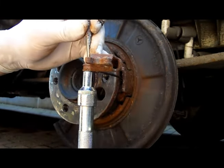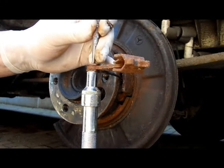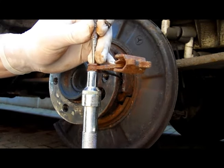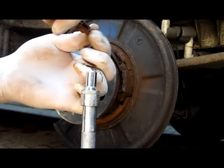It's worth noting that even if you were to replace the handbrake cable, you'd be replacing it from that seized linkage onwards, which means this is still an issue you might well want to address. The easiest way to fix it is to knock out the pin, give the whole thing a really good clean up, get it thoroughly lubricated, and then put it back together again.